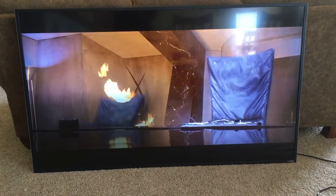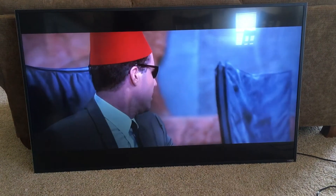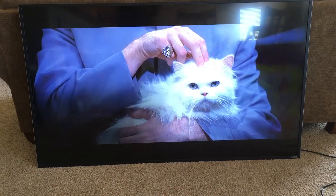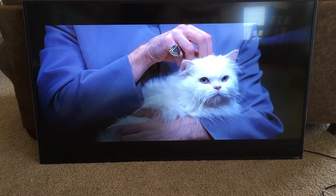If this is what's happening to your TV, while researching how to do this fix I came across several people who own the Vizio UM65D0 in the forums searching for a similar fix to the problem. So if this is you, stop here. Check your video board first, and don't just assume that it's an outage of the LED backlights, because that's not the case.